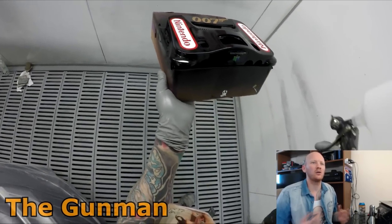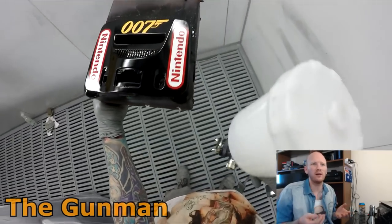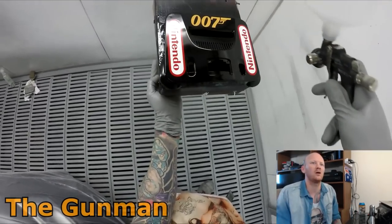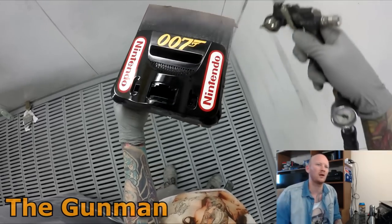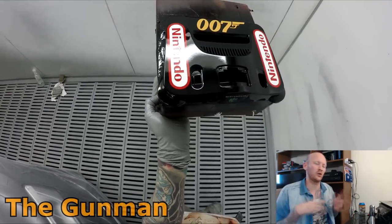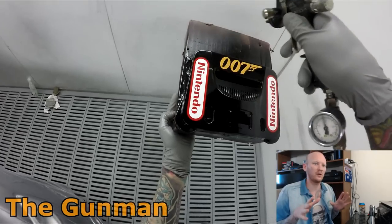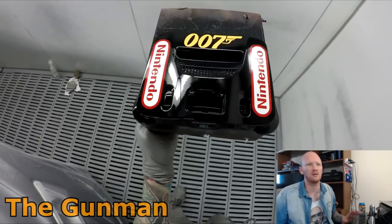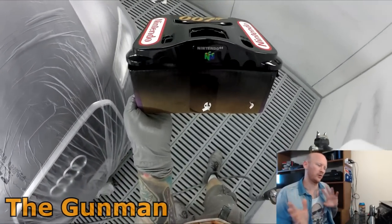So yeah, just two coats. I did put an extra little bit of clear over the stencils, so I smashed an extra heavy coat over where the stencils were, so it gave me enough to actually sand it down. But once I got the first two coats of clear onto the top of this, I thought, okay, half the battle's over now. I've got all the masking and the triple colors down. I can put that to the side.